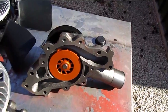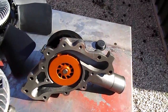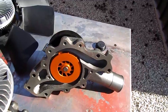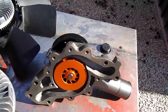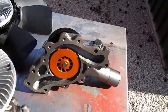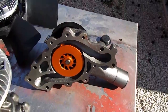The idea is to avoid steam pockets and anything like that, but the main thing is to get more cycle times — get the coolant to move through the radiator more times per hour than an old traditional impeller is capable of doing. Some people think you need to slow down the water to give it time to cool in the radiator, but that's not true. You need more cycle times — that's the key.